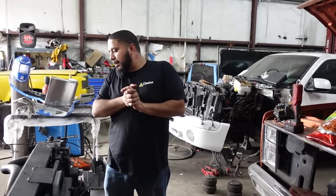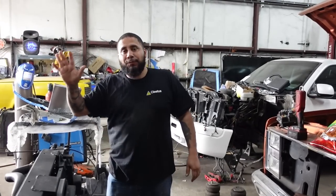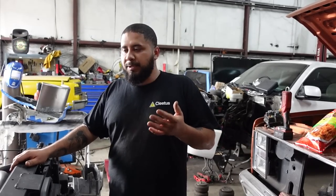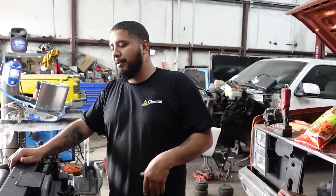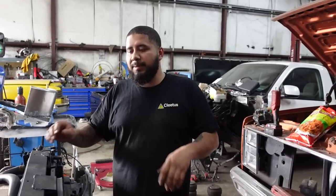So yeah, guys, like I was telling y'all, we're fixing to go drop some money off for this truck. Like I told y'all, Slam Specialties valve manifold. We're doing the controller, compressors, tank, fittings, all new bags. I didn't know we had already replaced the front bags with Firestone, because that's what it originally had in the front. I was looking at them right now and they look pretty new. There are no stretch cracks, no nothing, and they still have the little hair nipples and everything.